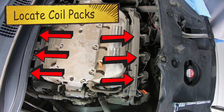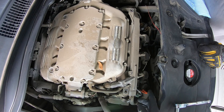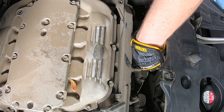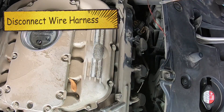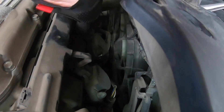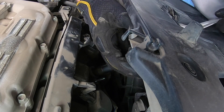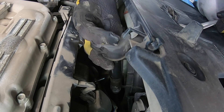You're going to want to find your coil packs. It's hard to show the back ones but the front ones are right here — you've got three of them. It takes a 10 millimeter socket and we're going to get the little nuts off of each one. Make sure to have a magnetic tray nearby so you can set the nuts in there. To disconnect the cable, I use a flat head screwdriver — press on the top part and pull with your other hand. Once that's up, stick it out of the way and then shake the coil pack back and forth and pull it out. It's a bit of a pain but it is doable — you just have to get the right angle. Then put your coil pack to the side.